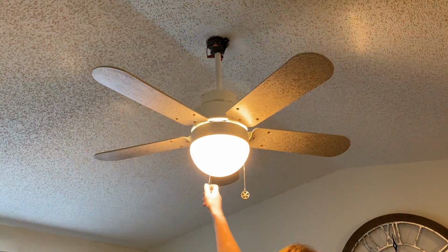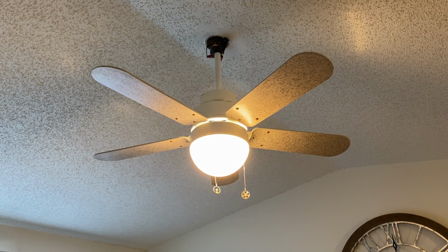These fans are extremely odd. They were a line of ceiling fans that Hunter introduced around 1990 or 1991. These fans lasted all the way to the early 2000s, with white being the last finish being sold. These fans came in 44-inch, as you see here, and 52-inch sizes. The 52-inch size and the 44-inch size both use a 172 by 12 millimeter motor with about a 12 to 14 degree blade pitch.